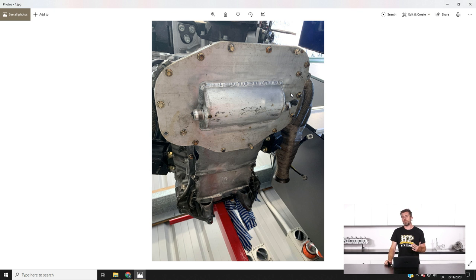The pump, which we can't actually see in this photo, is a three-stage dry sump pump. This means it's got two scavenge stages - the scavenge stages are what pull the oil and blow-by gases out of the crankcase and the sump, returning them to the reservoir mounted in the back of the car. And then the third stage is the pressure stage, used to draw the oil forward from that reservoir, pump it through the oil filter and then into the engine.